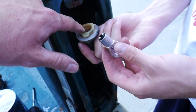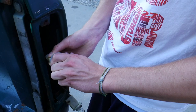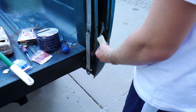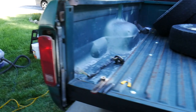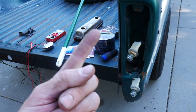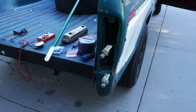If you look down in there you'll be able to see the column that it goes down in. That one looks like it's the farther one down the barrel — that one should be that one. And if you look at this one it should be higher up. Push it all the way in so it seats, and then you'll twist it back just a hair. Make sure it's down all the way in and then twist it like it's tight. Let's hit your brake pedal and see what happens. Oh yeah — that is much better. So it was either: connectors were dirty so you're not getting full signal strength through it, or it could be the bulb, or you have the bulb in backwards and it's not getting the full power.